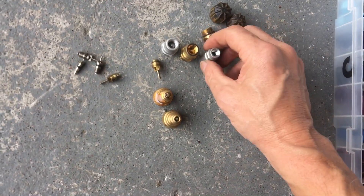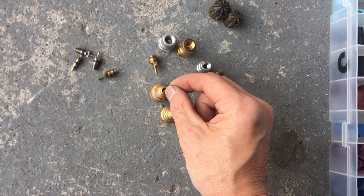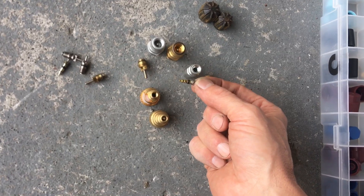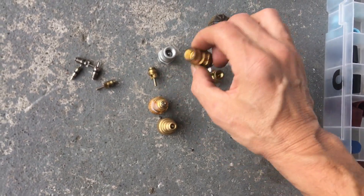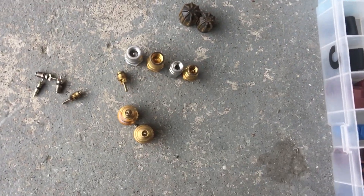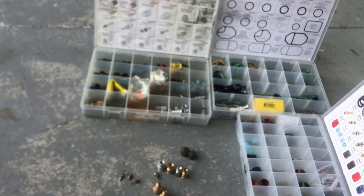That is the difference between automotive and commercial HVAC fittings, or the old-style R12. Now if I'm doing an old R12 car, I put my core remover on there and remove the cores. But if I'm doing R134, no need to — you've got ten times the flow compared to one of these even when you remove the core. Alright guys, I'll see you. Sorry about the noise out here. See ya, bye.